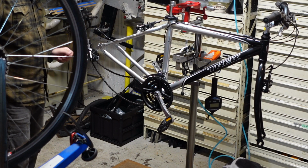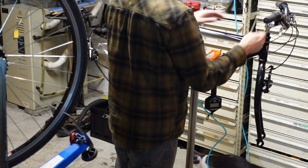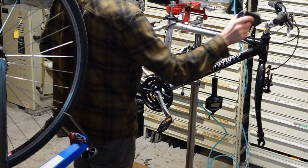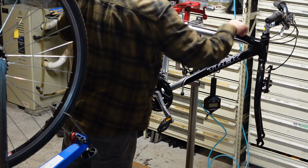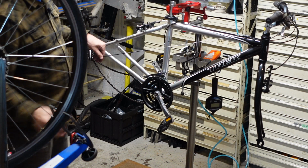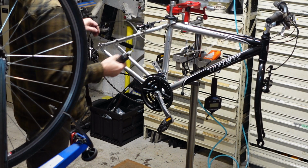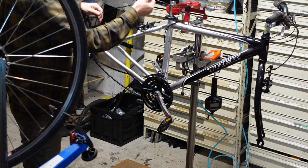Well, the way I do that is I push the derailleur in, take the back loop out, release that cable, and then just take my little bottle of TriFlow and give it a thin layer all the way around. Take the excess and rub it on with my fingers in the non-housing, exposed areas. This also spreads the lube when you do this. Just use the housing to spread the lube all across the cable. Just a nice couple drops all across it.